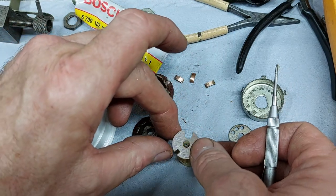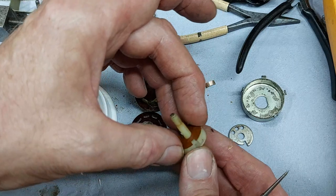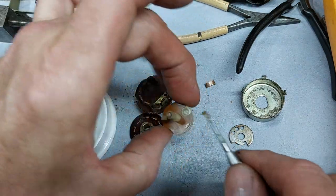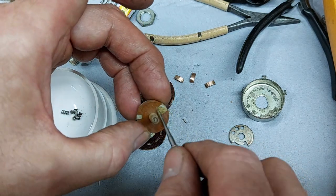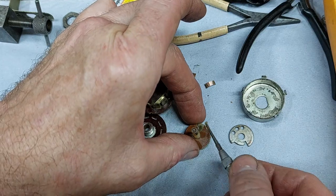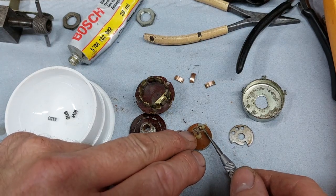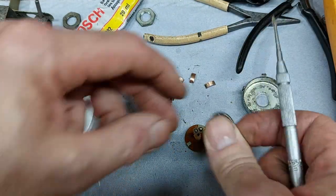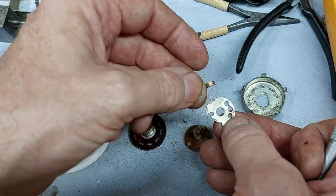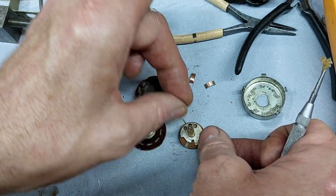And on there, like that. There's a little notch for it to sit in. There's that. Like that. Bit of grease in there for the small spring. Ball bearing, see if we can grab that on the grease. Yep. Okay. And then this plate goes on. You can tell which way it is because there's a wear mark on the back where the ball bearing's been dropping into the holes there. On there in the middle position. There.